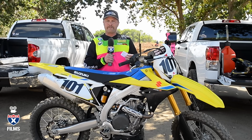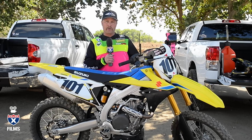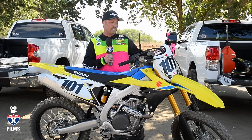So that's something you're going to have to play with and try to find a balance for you, depending on where you ride, if you ride further forward or further back, how stiff you like your stuff, what kind of tracks you're riding and all that. But I think that's a good starting point, what we've mentioned, and then consider playing with this fork height, just dropping it down in the clamp a couple of millimeters, and it'll make a big difference. You'll feel it.